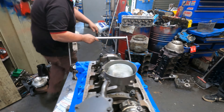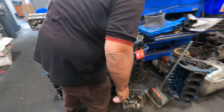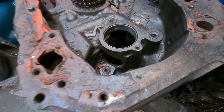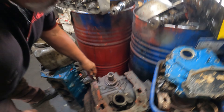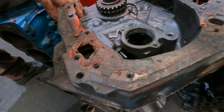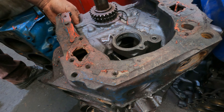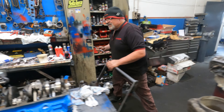It's going to be very hard to see, but the distributor goes through here and I'm going to put the pin in to show you what I'm talking about - I'm going to pretend this is your pump. So it's going to come through here - see that? When you get that drive, what happens is the camshaft spins the distributor shaft that's got teeth on it, which has got the allen key part that goes inside the distributor, and drives the pump. That's how this actually works.